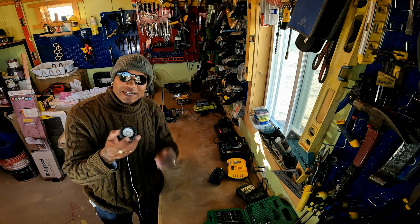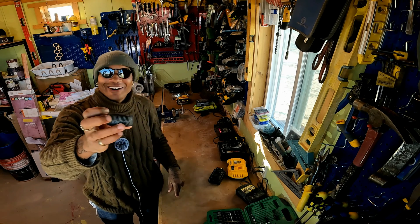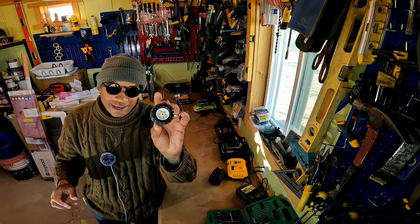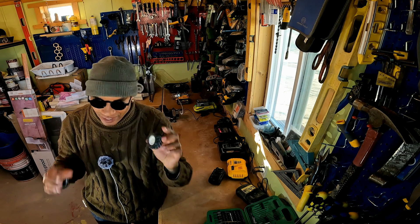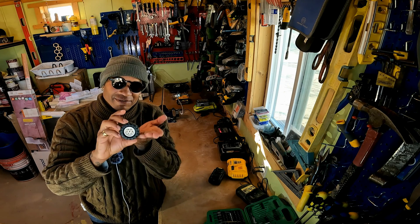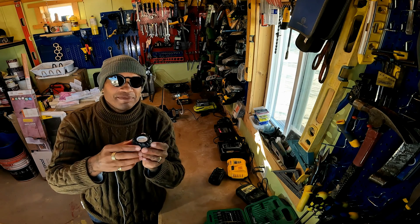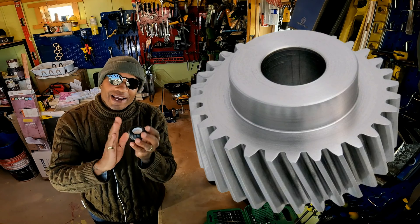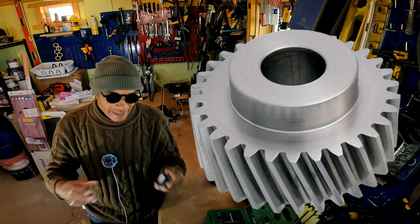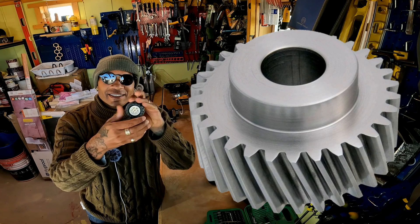On to the magic. Pretend this is a planet gear in the differential. Here's the secret: unlike normal planet gears, this gear is not straight-cut. Normal gears have straight-cut gears. In your actual Torsen Type-C differential, this planet gear is going to be helical — it's going to have those angular teeth to it. The secret is that with helical gears, when they start to spin fast enough, something special happens.